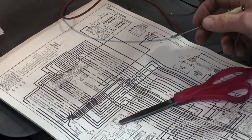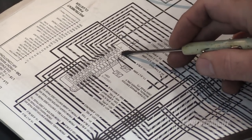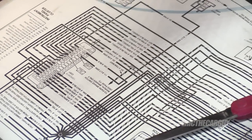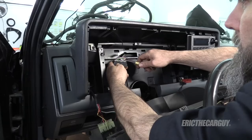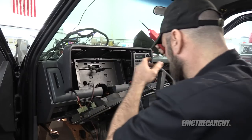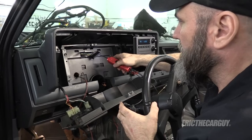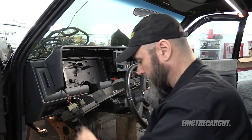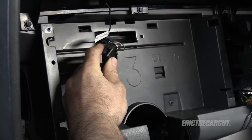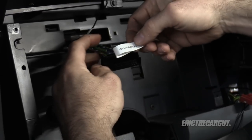Now I'm going to test my theory and see if the harness actually contains the wire for the high beams. It comes up from down here and comes in just two down from where our ground was — it should be light green. So if we've got a light green wire here in the harness, that could be our high beam indicator. I'm going to verify that theory by first turning on the headlights. And yeah, it's high beam. Turning that off — that light green wire is going to be our high beam, so we'll cut that out.